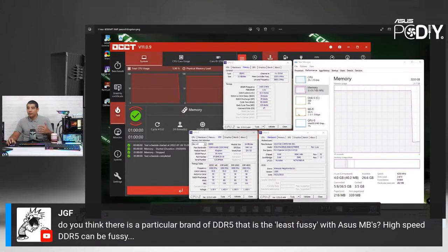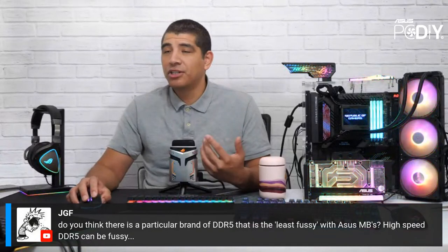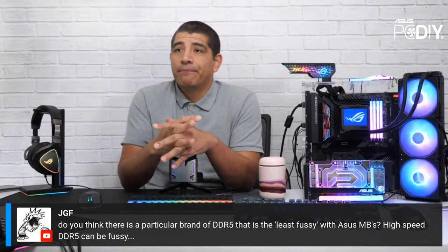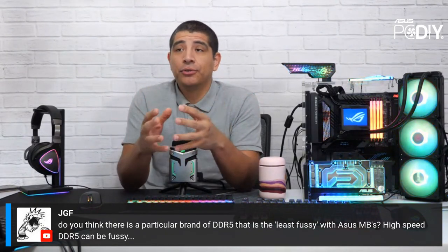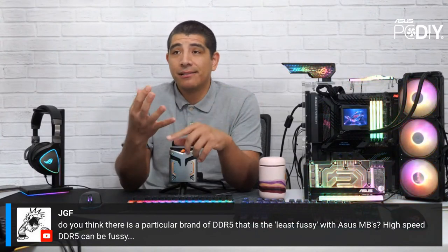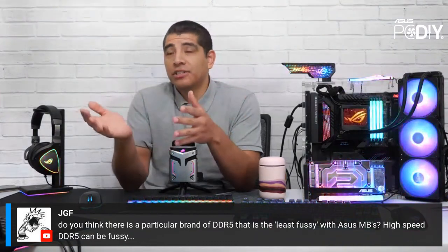So it's not an issue really on our part in terms of the board. We've done a huge amount of work in terms of the topology and the UEFI to be able to support it. Just be mindful of the memory. So I would recommend don't go over 6,000 MT unless you're prepared to manually set your memory divider, because your CPU may not support that. If you bought 62, 64, 66, you could definitely run into the likelihood that your CPU doesn't support that.